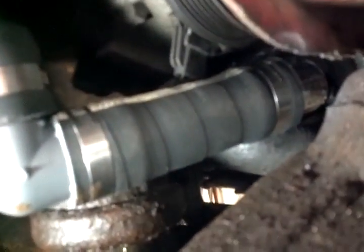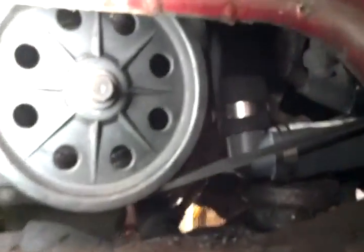So, and then I wanted to do just that single swoop, but I don't want to take a chance of the hose kinking just for the cost of 2 clamps, and under $2, $1.79 or whatever for this elbow. So that's pretty taut right there. Start putting the rest of it back together. I still got to tighten the clamp on the other end. Got the harmonic back on, belts back on, plenty of room between there, and because this hose is stiff, good braided hose, it stays in place there.